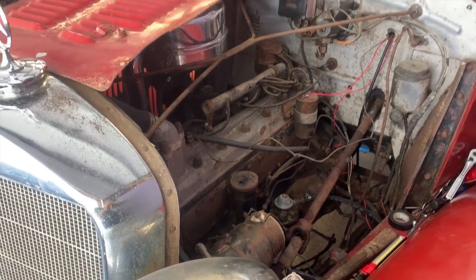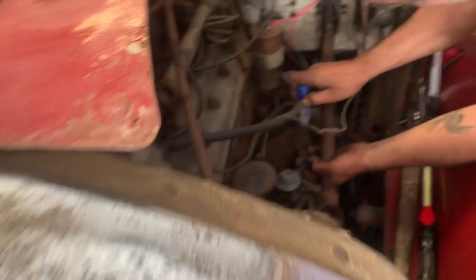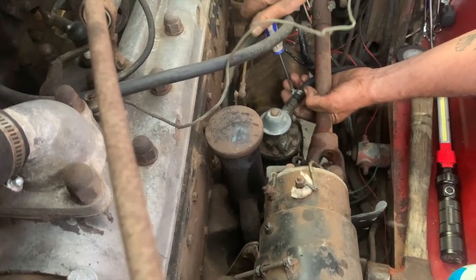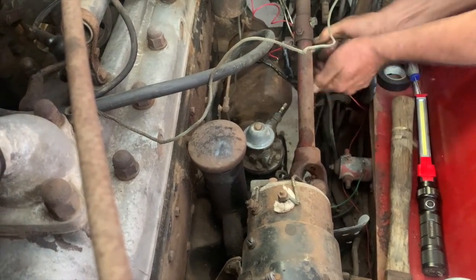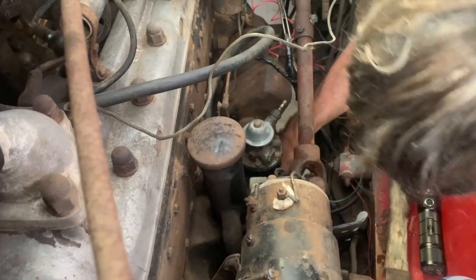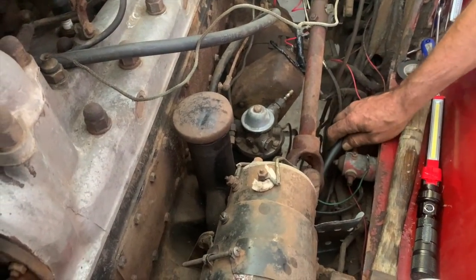Still nothing. I'm thinking that fuel pump is just weak. It's just not pulling, because you're at a level where you're sucking gas out of it. What's the access to that thing like? Well, you can get to the fuel pump easy, but trying to find the parts to make it go might be difficult.